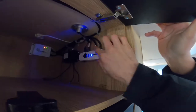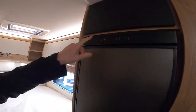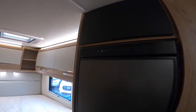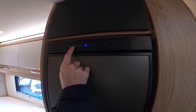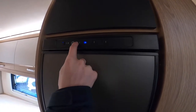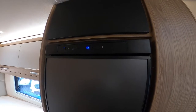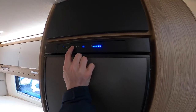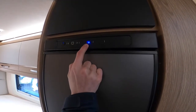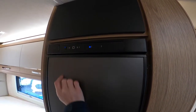And in here you have your TV aerial booster — you can boost the signal on the wheel. Now onto your fridge — this is your Thetford fridge. You turn on and off here. If you press the square button, you can see what source you're on. Press and hold and it'll start flashing and you can move the arrows to change source. You've got hook up, which is mains electric. You've got battery, which is designed to keep the fridge at the temperature it was when departing — like a cool box — and it is powered off the engine battery, not off the leisure battery, so only when the vehicle's running.